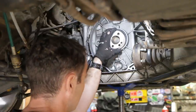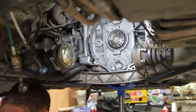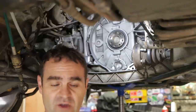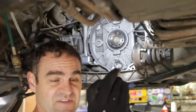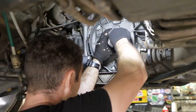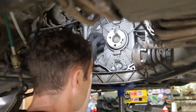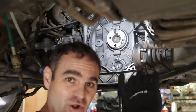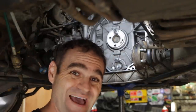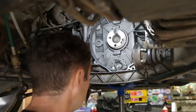Basically how I'm going to do it is — this is just a PVC fitting for a three-inch downpipe connector. I've drilled holes in it so it'll actually fit over the top of the crank, and then using the crank bolts and some sockets as spacers, I can bolt it up and check the measurements, pressing it in slowly and evenly to get it exactly right all the way around. To pull the old one out, I have to drill a hole no more than five millimeters deep into the seal itself, put a screw in there, and lever it out from the screw.